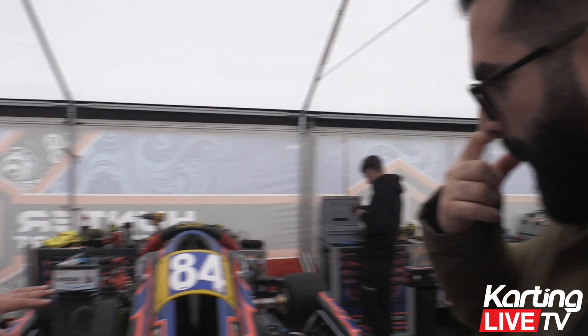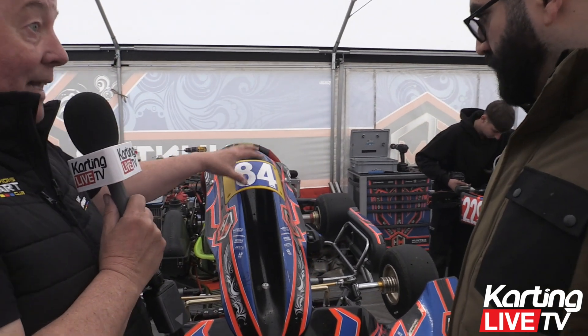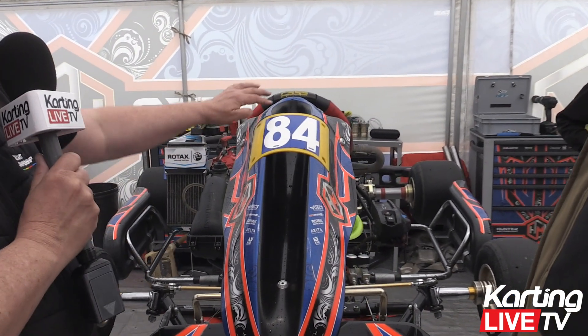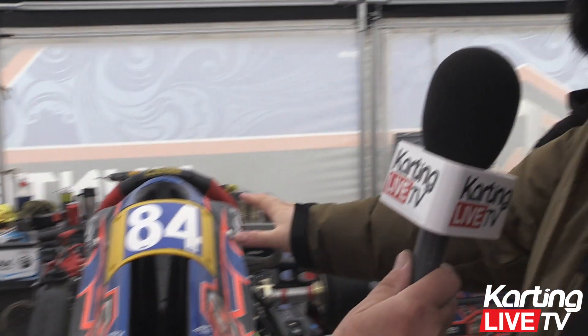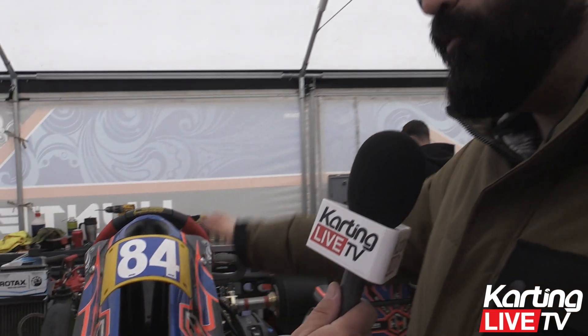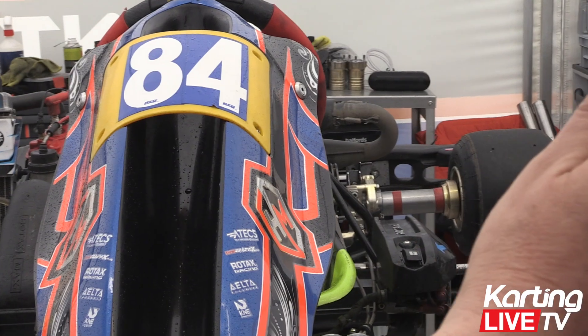This is Senior Rotax — the driver is Elliot Dolton racing with Hunter Motorsport this weekend, and Elliot is a tall lad, so that's working well for this particular size of driver. Exactly — if you've got a tall driver I think this is the best setup, but if you've got a shorter driver I would say go down a different route. You can also see on the sides of the panel it's sculpted quite well, and again that's to feed air around the driver's shoulders as best as possible to reduce that low-pressure zone behind the driver and reduce drag.